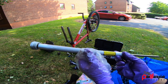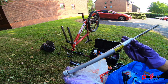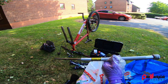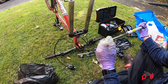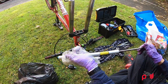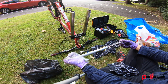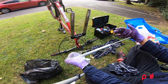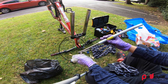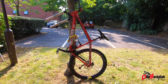It is confirmed that something is wrong with the fork. Because this is a sealed system I can't really do anything much about it — I'll probably have to get a replacement. Nothing is wrong with the spring; something is wrong with the damper. What I'm doing here is trying to confirm that something is wrong with the internal valve system in the damper. This thing can only travel about 3 inches, and that's not going to cut it.